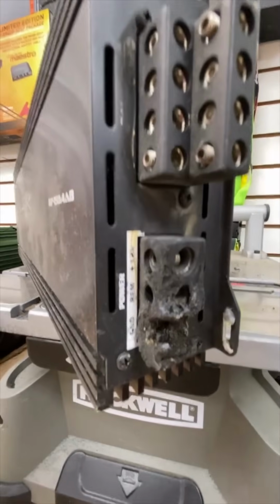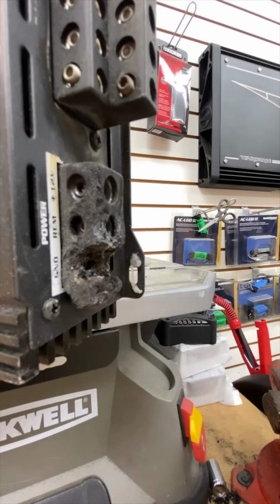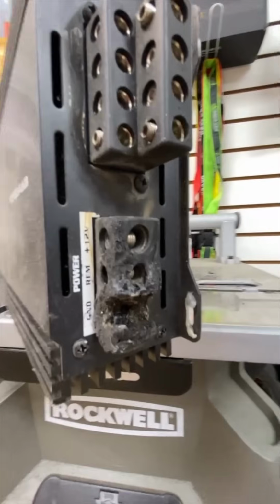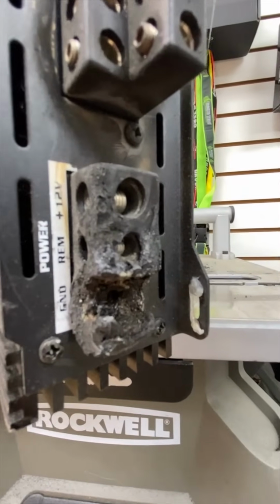What happened to Scar Amp? So that Scar Amp, the one that we converted, was an RP amplifier that died for some reason. Let me tell you the story, because you guys always love stories. This amplifier came to us because some doofus used some CCA wire into his amplifier and didn't use a ferrule and didn't ever check it and didn't know how to tighten it down, and he didn't figure out that when the amplifier was cutting off all the time, he should go check it out. So he literally just lavaed the side of this amplifier with his crappy ground connection.